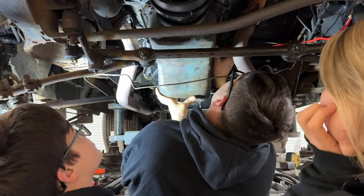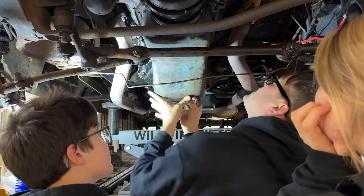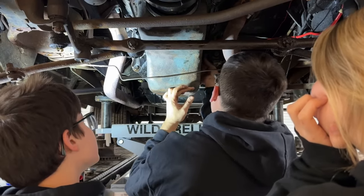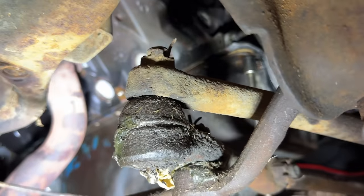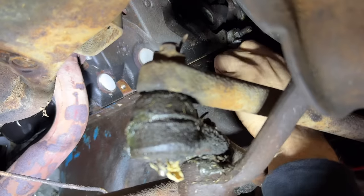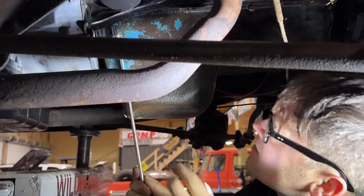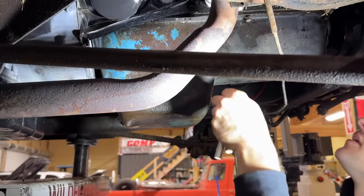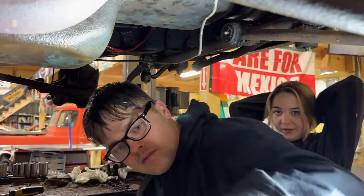We definitely gotta be more careful with this gasket because it's just cork. You can crush a cork gasket. That rubber one has metal shims in it that stop it from being crushed. This one does not. You can see the silicone squish out in those corners. It has reinforcements at the back two bolts, which you would think would help this seal up. Did we ever find out what really caused it, or is it just a guessing game at this point? Just a guessing game.